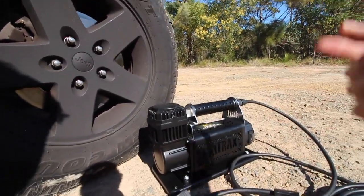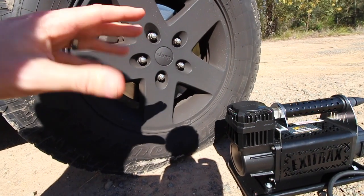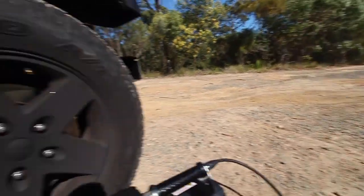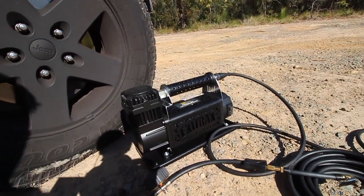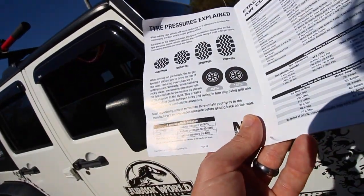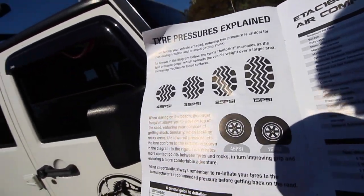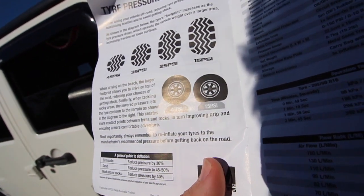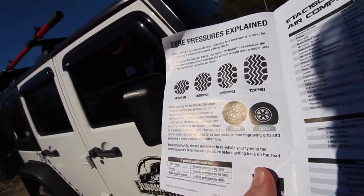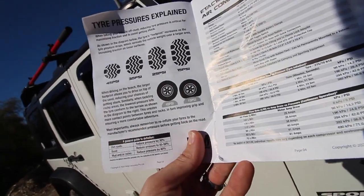You're probably wondering how long it's actually going to take to fill up. We've dropped the tyres down to 25 PSI — I normally run them at about 35 to 37 PSI depending on what I'm doing. As you can see there's a nice bulge in the bottom of the tyre. A great thing if you're new to four-wheel driving: the user manual actually gives you a guide about tyre pressures — dirt roads reduce pressure by 30%, sand reduce by 45 to 50%. Everyone knows dropping your tyre pressures gives you a wider footprint, which increases traction off-road, on the beach, rock crawling, whatever it might be.